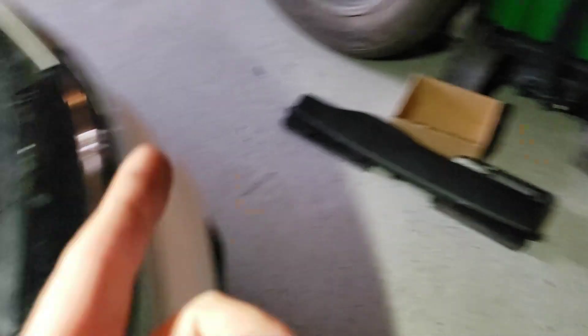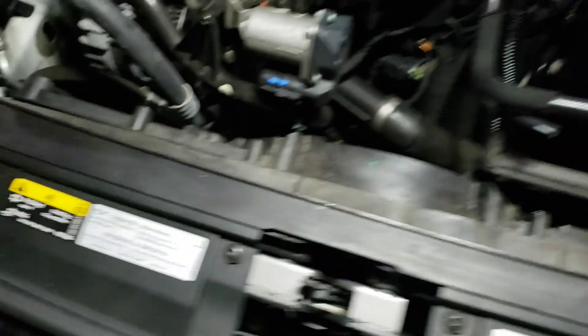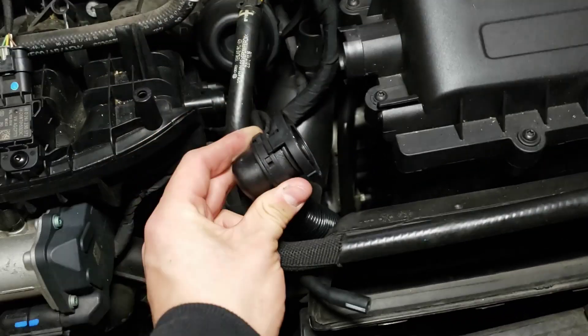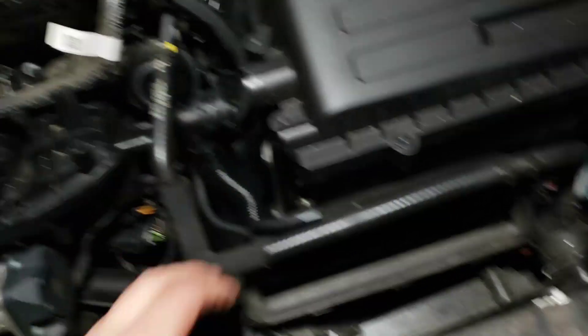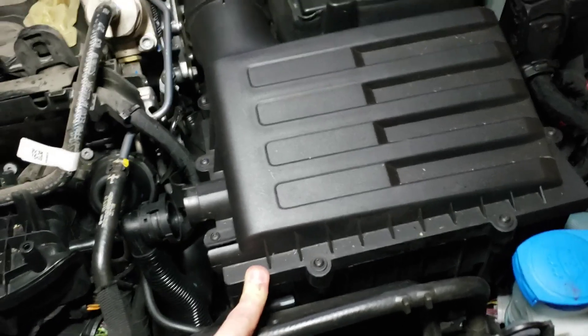While removing the air box, you have to take off the front cowl, which involves these two screws right here. Take this off, pop the passenger side out, then pull it out from the driver's side. Don't forget to remove this line here and your other line - just use a little pry tool or flathead screwdriver from the back. The next step is to take off the lid of the air box and pull it straight up off its studs.